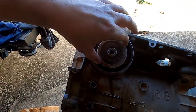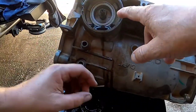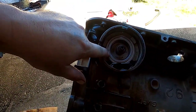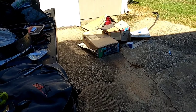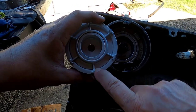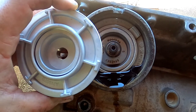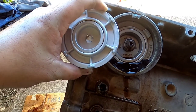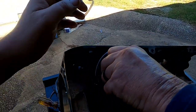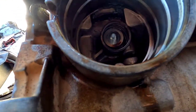We're replacing this servo here. Not this one, that's fourth gear. This is what's going to go back with a Corvette servo. And the difference is the amount of pressure room. This is the surface area difference between the outside and the inside. See the size difference? So that's going to create more pressure, more holding force for the band, more holding power. So we removed our check ball that was leaking, which bleeds out.